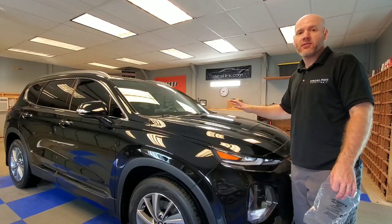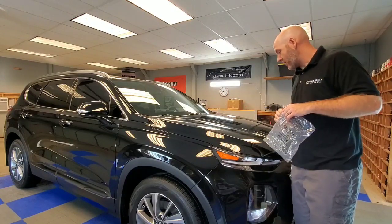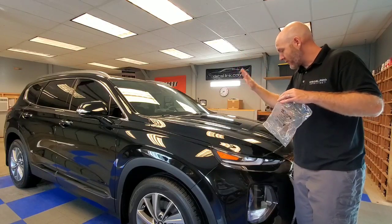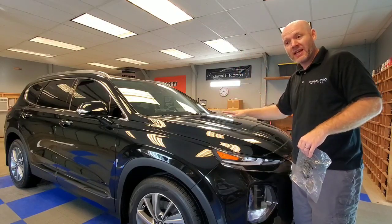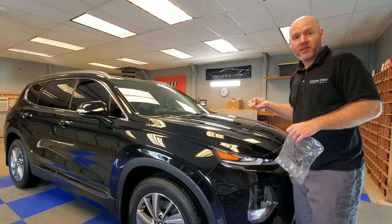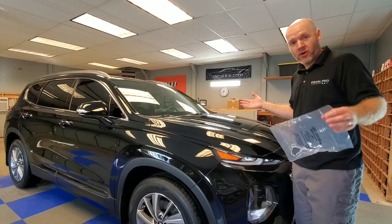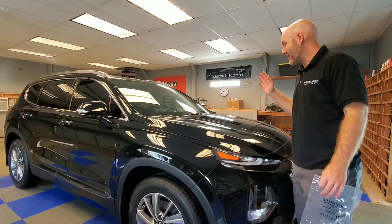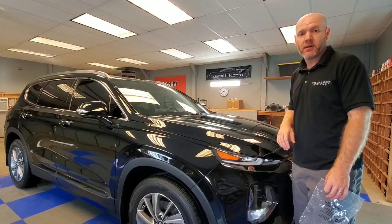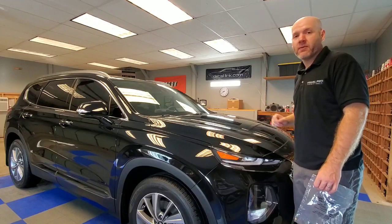You need a surgically clean surface because if you have contaminants on the surface before you apply the coating, the coating or wax or sealant is going to sit on those contaminants instead of bonding to the clear coat. The product won't bond properly and it'll fail prematurely, wasting all the time, money, and energy you've invested because the surface was not prepared correctly. Let's go ahead and get this thing clayed so we can get ready to polish.